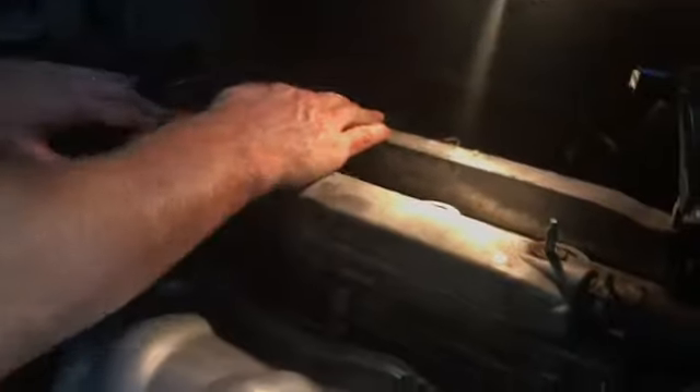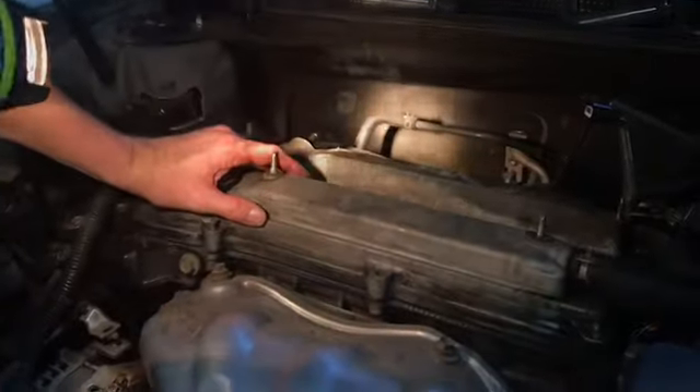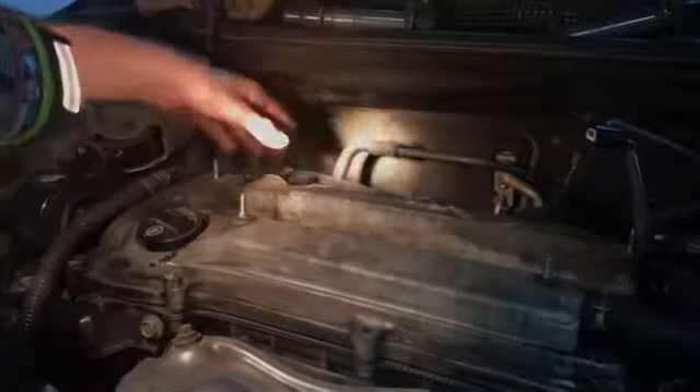It should just go right down over the posts. Then look to make sure that the gasket isn't twisted — I can still see the blue of the gasket. Before I tighten it down, look all the way around to make sure there's no obvious twisting or any problem like that. Once done, start putting the hoses back in there, the PCV valve which is over here, put that back in there, and then start putting some bolts in.